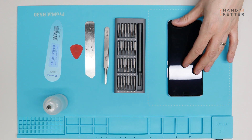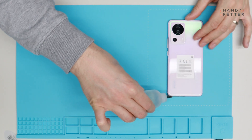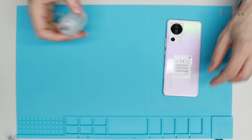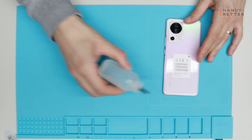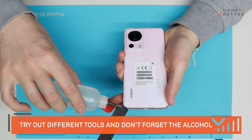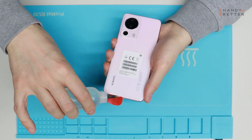And then I will start opening the back cover. First of all I will use the alcohol — I still have it on my heat plate and I will put some drops of alcohol around the frame. It will help us because it will make the adhesive tape weaker so it lifts up more quickly. Especially where I try to enter the device on the corner, I will try to go in here and put a little bit more. It's still hot and now we are going to put the metal one in. I remove the metal one because, to be honest, it's too dangerous to use for the whole device. But now I have the perfect entry and I can go all around. Always put some more alcohol on it.